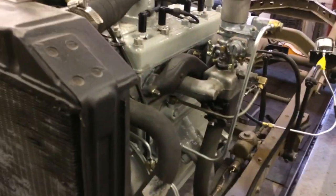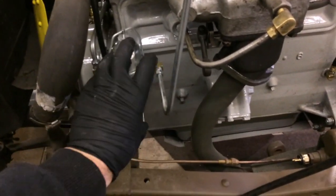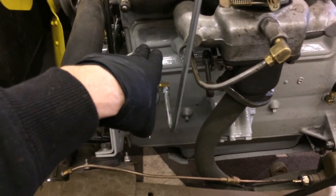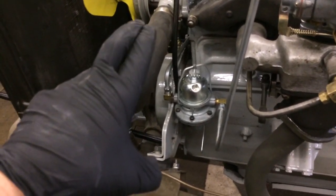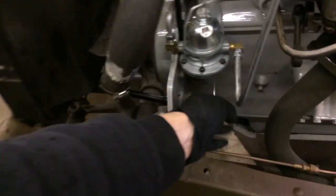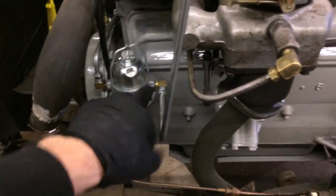Anyhow, so yeah, petrol comes up well, which is good. It means that the fuel pump is on the cam. Sometimes you put the fuel pump in, and it doesn't lie under the cam. All fuel pumps in a way have inside like a lever like that, and they go onto the cam. The camshaft there is turning and it's basically doing this. I'm pumping fuel into the reservoir here. Now, this cam is pretty close to the side and it's very easy to lay on. So sometimes you put it in, you think it's on, but it's not.